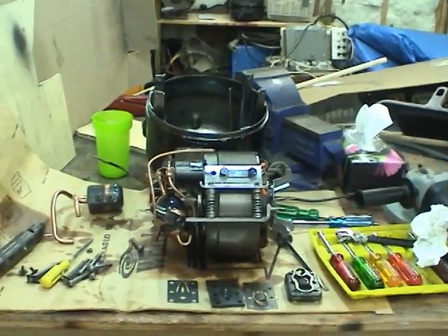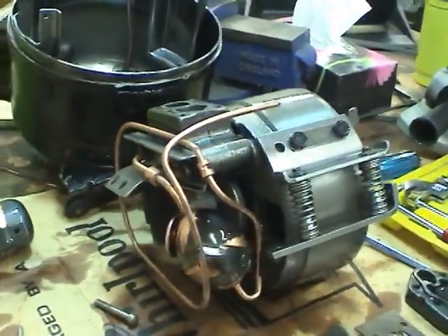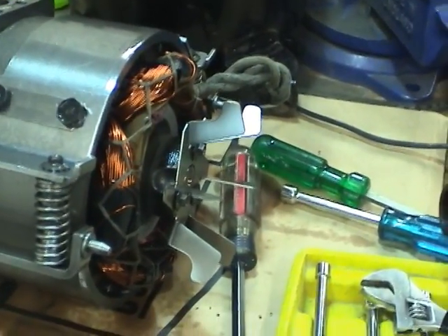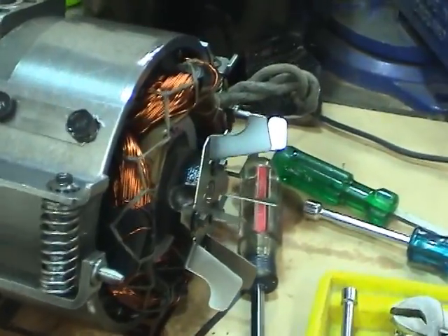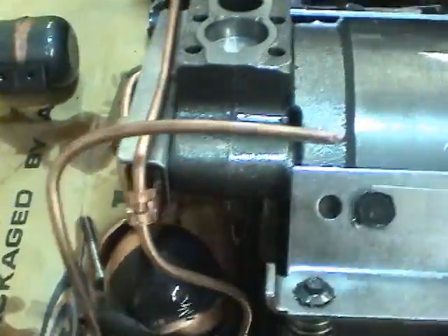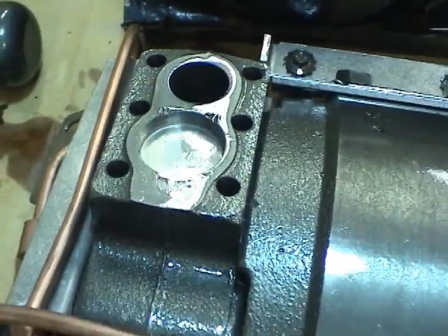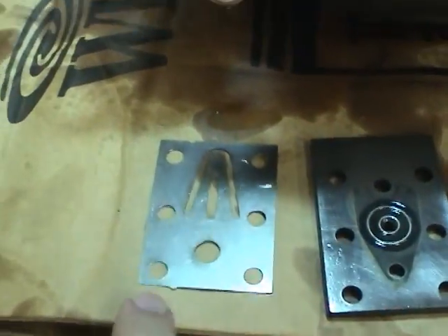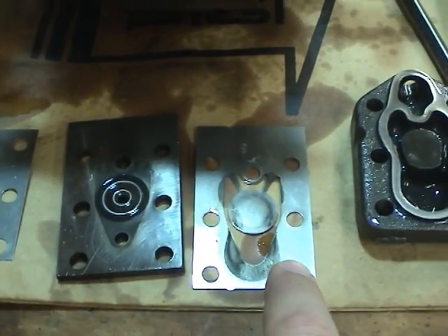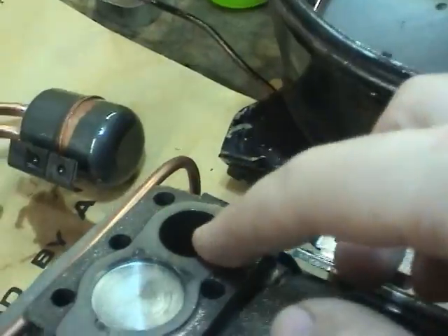I got the compressor out of the case now and it's quite a bit shorter than I thought. This compressor also has a fan like the other one — I guess the windings in these old compressors are not rated for very high temperature, so they need pretty good cooling. There's the piston in there, there's the valve assembly. This one goes against the piston. There's the center plate, that's the discharge valve, this one's the suction, and then this top piece directs the gas flow down into the exhaust.